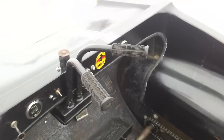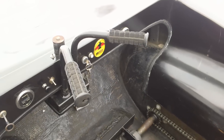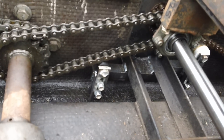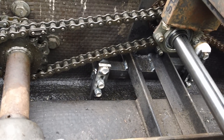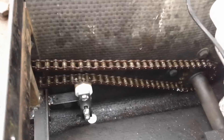This happens basically instantaneously — you can go forward or reverse on both sides, lock the thing to counter rotate, go forward, or go reverse straight. I've added roll rings to keep chain tension on the front-to-center axle. You can see I put a tensioner in the drive chain that goes to the center axle. There's an auxiliary shaft here that's actually driven off that transmission, and it drives the center axle and the rear axle.